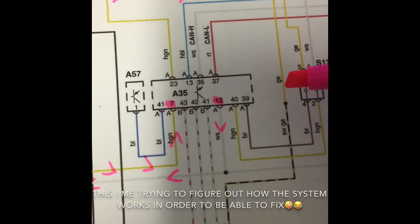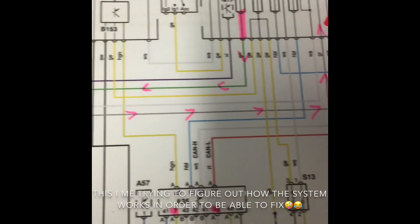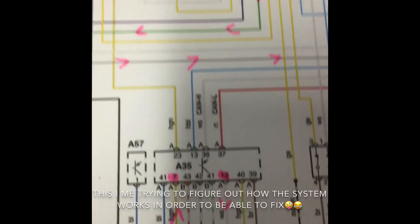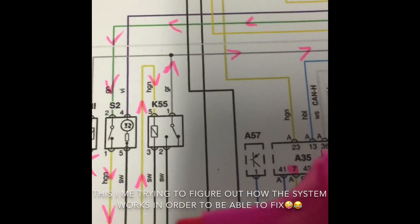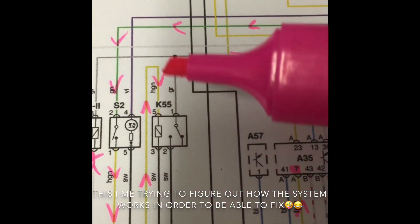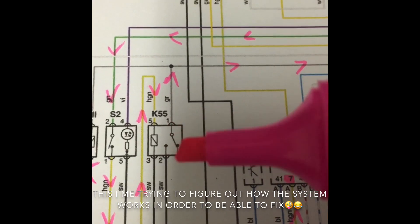That's the inhibitor — it's a little bit of a complex system. When I run the key — that's actually the ignition switch — when I turn on the key I get power into this fuse box and into the engine control module. When I press the button here, I should have power coming down this wire into the switch, out and into the engine control module, and coming around and up into the inhibitor. When I press the button, I get a click, so I'm assuming that's working.